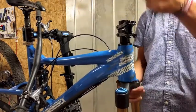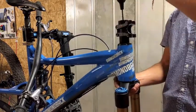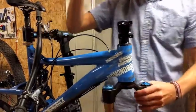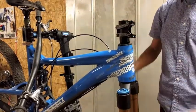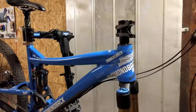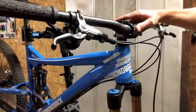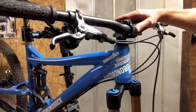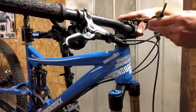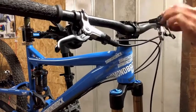Once that's on there, go ahead and tighten it down correctly. We're not going to be doing any torque specifications right now, but do not forget to do that. As I spin the fork, it's moving freely — there's no resistance. Everything has been put on correctly. My top tube fitted really nicely; had enough space for that cap to just pop in there. And the top bolt connected well with the star nut.